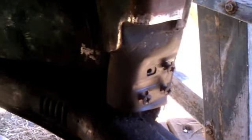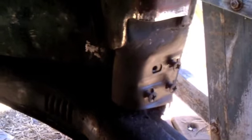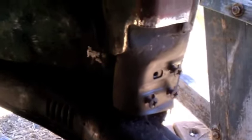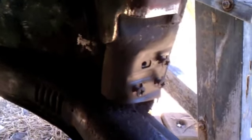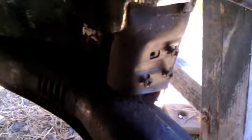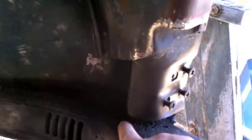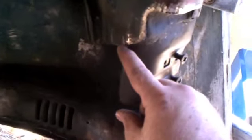Okay, now I got the hinge plate, the backing plate, welded into place. And it's time to cut the fascia piece to fit and weld it in. And also going to drill some holes along the front, because that front's going all the way to the bottom here. It's going to weld to the bottom, weld to the top, the edges. It's going to be very solid.